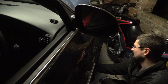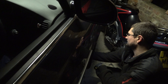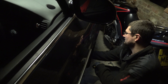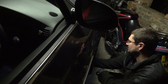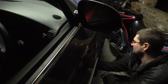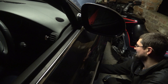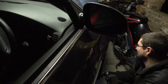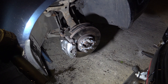It's pretty stiff already. Pumping the brake pedal — down, up, down, up. Got a bit of something coming out. Keep pumping — down, up, down. Oh, that's solid. Give it a few more pumps. Right, that's the job done.